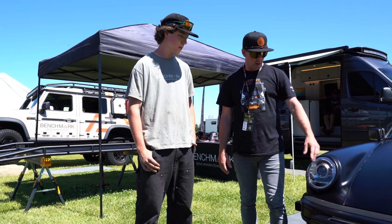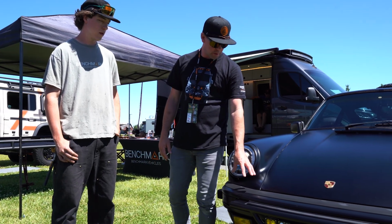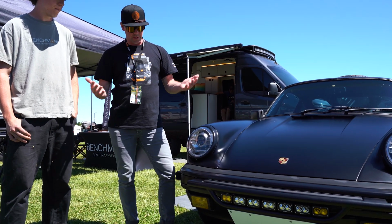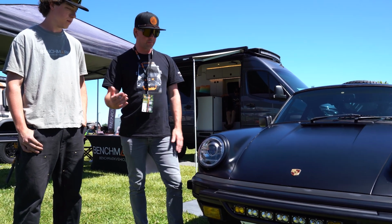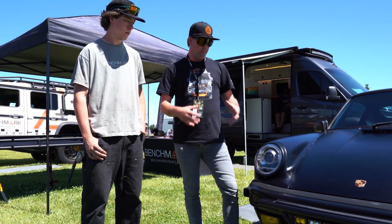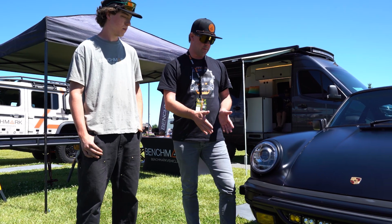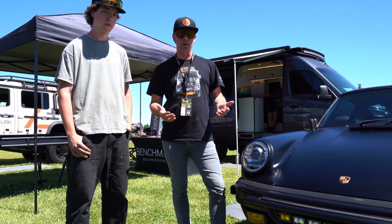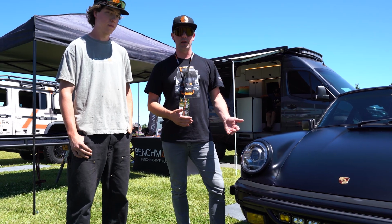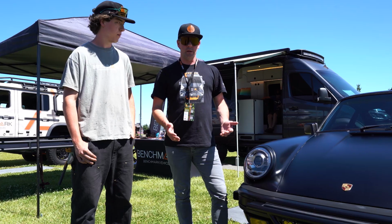Yeah. So that block is tapped from the back side and a little bit behind what's going on this front bumper. So the factory bumper was actually tucked. So call that in automotive world, custom world, tuck the front bumper. So what does that mean? Well, we modified the bumper mounts, and this car, it's a US spec car, so it had compression pistons for the bumper. It's a 5-mile-an-hour crash bumper essentially that was required on many of these European cars that came out in the 80s. So of course we ditched those pistons.